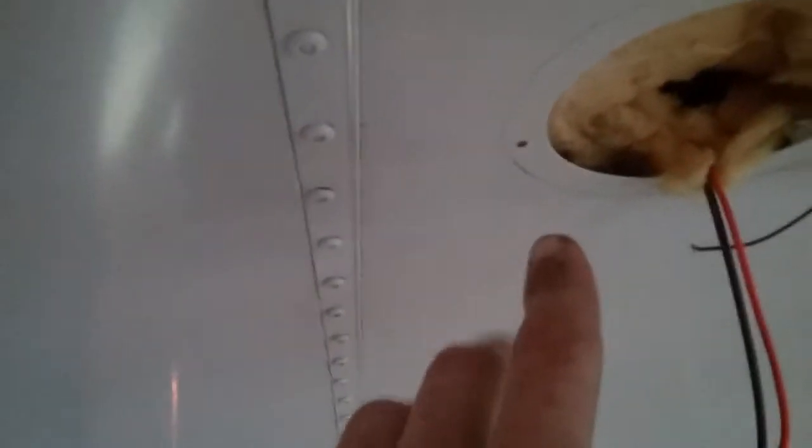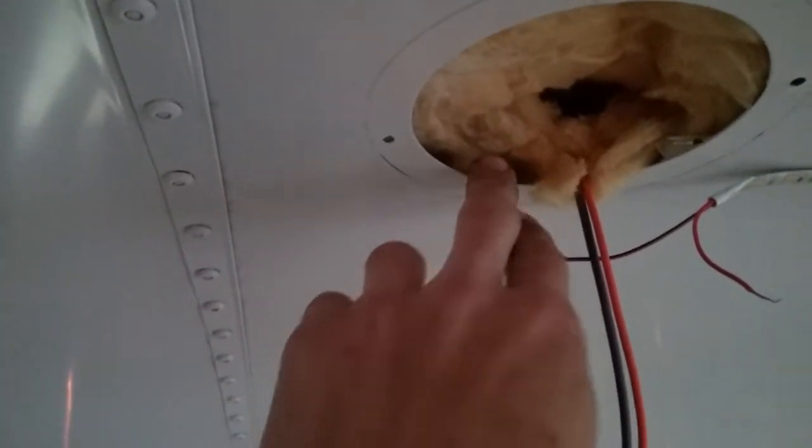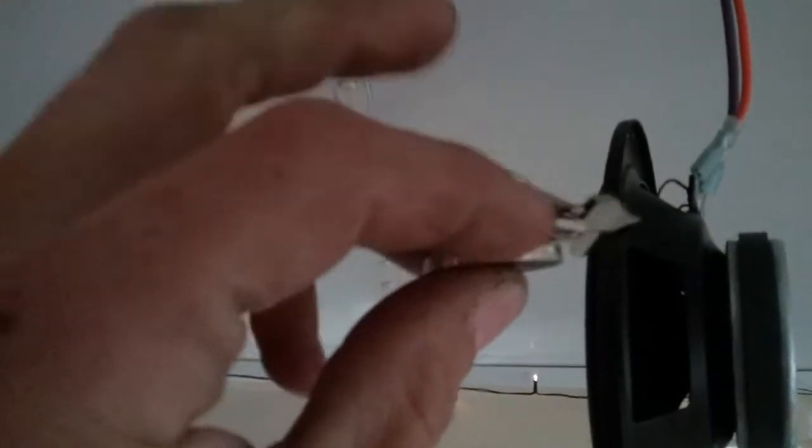I'm doing the lights and pulling power wire through here. I wanted to give you guys a little tip: if you're doing what I'm doing and you're going to cut circles in the roof to do the recessed LED lighting for RVs and you want to pull power wire through, you use something like this — these magnets that have clips on them. You clip your power wire to them, sit it up there, bend down this piece so it doesn't catch on the insulation so the whole thing is smooth — you can even cover it in smooth tape. Then you put it up there and get a really strong magnet and just pull it to where you want it to go, and that thing will follow it and pull your wire right through the top of the bus.